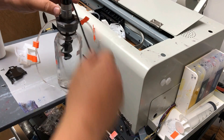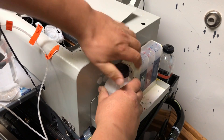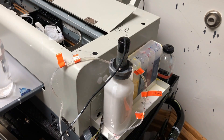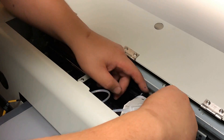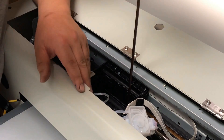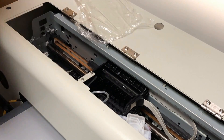Now I've got the tube ready and we can put the screw back. By the way, you don't have to do this every time — I'm just showing you how it's done. Next time, you can just remove the whole thing and put it in the white ink tank. What you actually do every time is just unscrew the top and put this whole thing in. The gray cap with ink is going to be available on my website. Now we put the print head on, put those FFC cables inside the curve, put the three screws back, and rotate among them to evenly screw it onto the chassis. Make sure it's tight and even, put the cable clip back, then put the damper holder back.